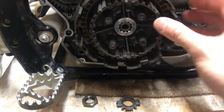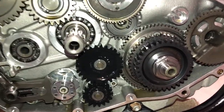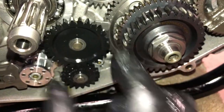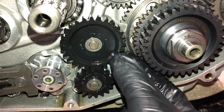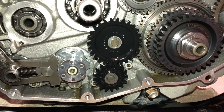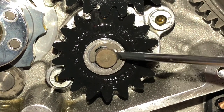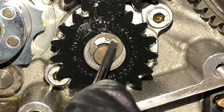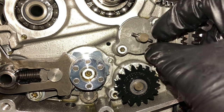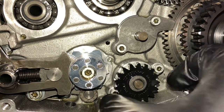No problem. With the nut loose and the retainer removed, the entire clutch basket assembly slides right off. With the clutch basket removed, you can see the two black plastic oil pump gears. The larger gear has a bit of shaft in-play, and there's a heck of a lot of slop in its fitment on the shaft. The smaller gear is loose but not quite as bad. The plan is to change out both gears with parts from a 2011 model, which has revised dimensions and a tighter fit. To remove the gears, a small flat screwdriver helps remove the E-clips — just put it into one of the slots and pry it away from the center of the shaft. With the E-clips removed, pull the gears and their washers straight off the shafts, then remove the cross pin behind them. Make sure the washer hasn't fallen down into the E-clip groove.